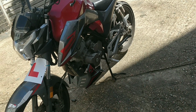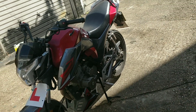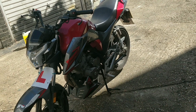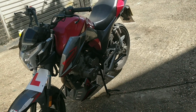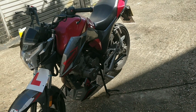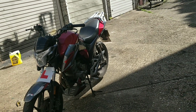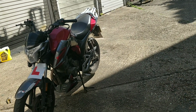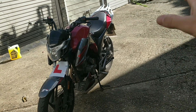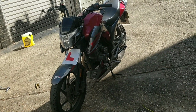Because at the moment I'm not hugely worried about it. And the last owner said it's fine when you're in gear anyway, it's when you come up to a light and clutch in that it lowers too much. So I'm not overly worried, but let me adjust the idle a tiny bit and see if it makes a difference. At the moment it will idle on its own here, but once you're going through the gears and the motions, it dips a bit lower than it wants and cuts out.